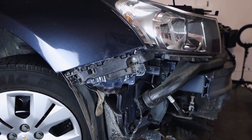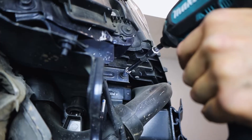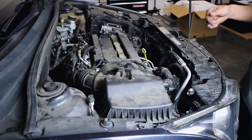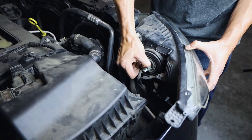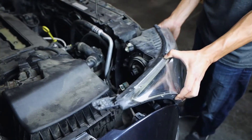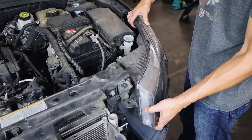There are two more 7mm screws holding each light on the bottom. Make quick work of them, then simply repeat this process on the other side. With the lights loose, we can now access the connectors on each to detach them. There are two connections on each side to be disconnected — simply press in on each and pull. We can now remove the OEM headlights.